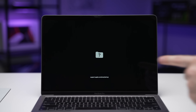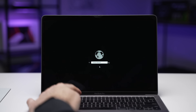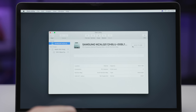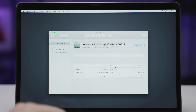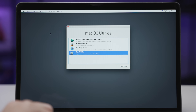This little flashing question mark folder might seem alarming, but it's actually a good thing. That just means the Mac is detecting the drive but there's no macOS installed on it, obviously. Holding down Command and R at the same time will get me to internet recovery. From here I'll need to format this new SSD. Going into Disk Utility, you can immediately see OS X Base System, which is essentially just a tiny little bit of storage built into the MacBook for recovery purposes. Selecting 'Show All Devices' will bring up any storage devices your Mac detects, and I can see the Samsung drive is successfully showing here with 512GB of storage. So I clicked on Erase, gave the SSD a name, and ensured that GUID Partition Map was selected for the Scheme option.